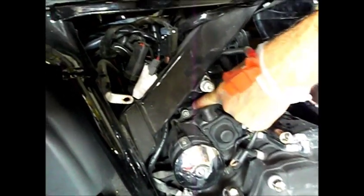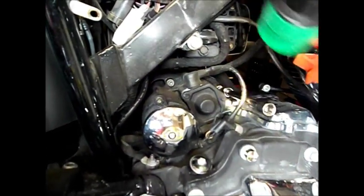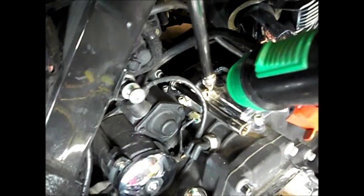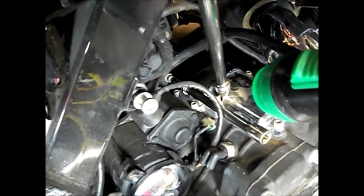One bolt here and one bolt here. There's one bolt here and there's one bolt here. The starter itself doesn't have to be removed from the chassis per se — it just needs to be loosened from the primary. Also, you see this hole here — that is the transmission vent line, and I went ahead and took that out simply to access this bolt a little bit more readily, and it's working out just fine.